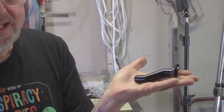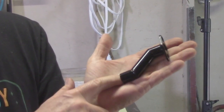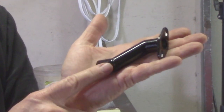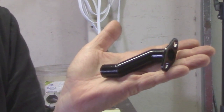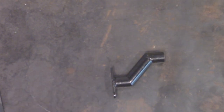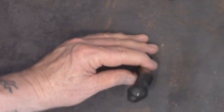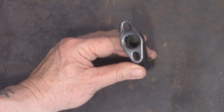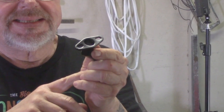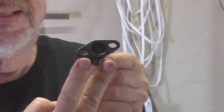This gizmo I have in my hand is called an offset intake. You might need this for an application where there's simply not enough room for the carburetor to go onto your intake and fit underneath your down tube, or it blocks the throttle cable from going in — you just don't have room. It offsets the carburetor about two inches to the right and back a little bit and enables you to get your carburetor mounted. There are three different styles of offset intakes: 32 millimeter, 40 millimeter, and a universal one that fits both. Make sure you get the correct one.